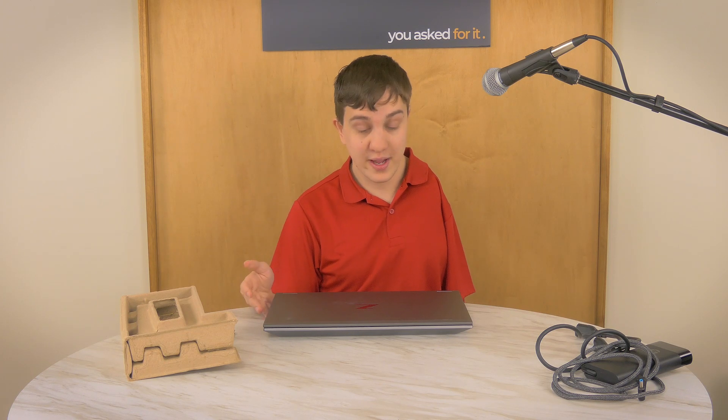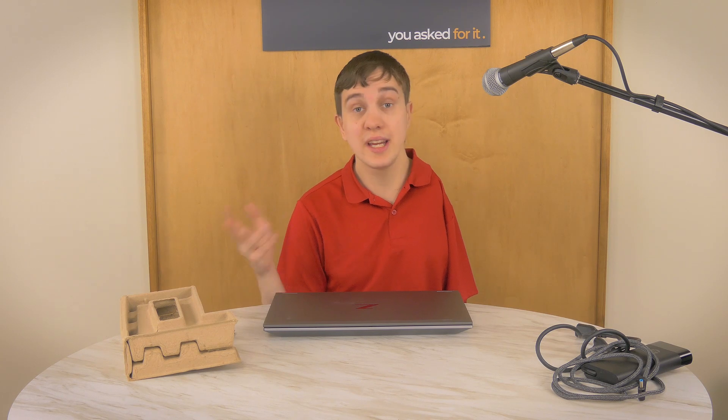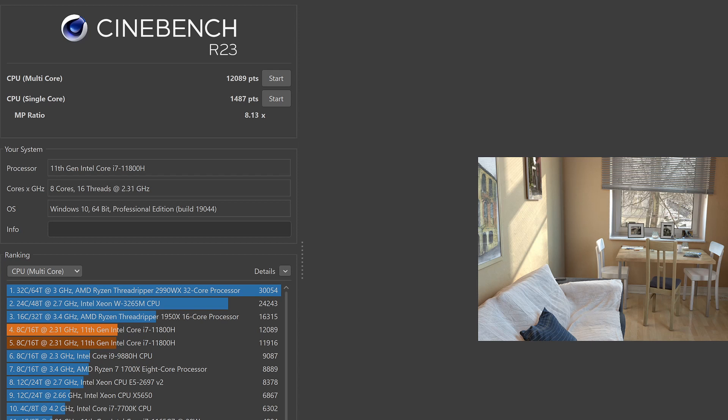It is not lightweight or thin, but people who need to get real work done oftentimes don't want or need lightweight and thin — they just need something that isn't a desktop that they can take with them. In terms of CPU performance, it's very desktop-like. With the i7 8-core, in Cinebench R23 it scored around 12,089 — and you may get a little more depending on the cooling solution, as this has a vapor chamber. A friend's desktop Ryzen 9 5950X with 16 cores scored about 24,000, so scoring roughly half that with only 8 cores is impressive and suggests similar per-core performance. I'm very excited to see what I can do with this laptop in the coming weeks. My name is Andy Silvers, and I'll see you in the next video.